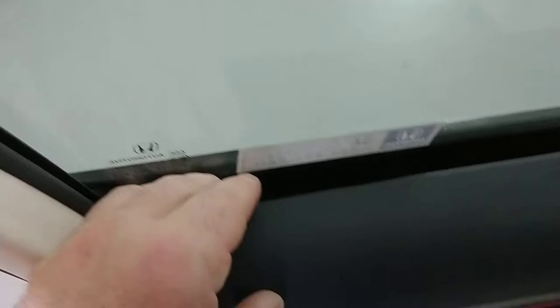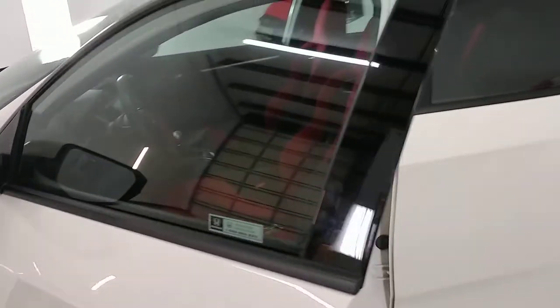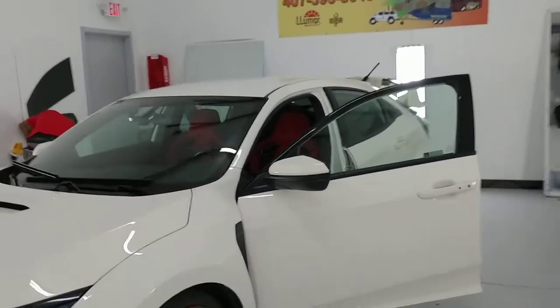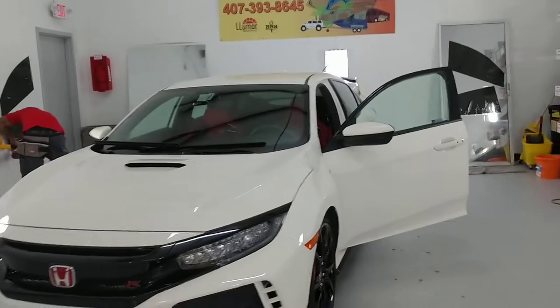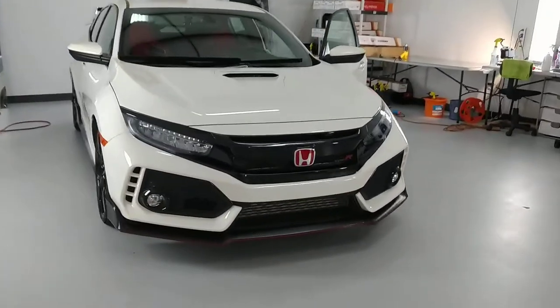We do remove the sweeps on here — we do that when we can on vehicles. This is a technique called bottom loading, which means we just slide it in there and get it in place. That way we're not fighting the sides causing it to pinch or get dirt or felt. You can learn more about our window tinting services, including residential and commercial, at tintmanfl.com.